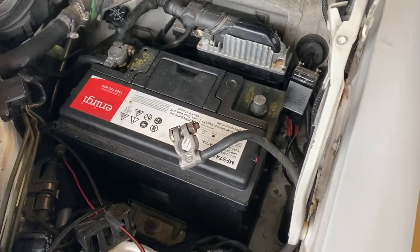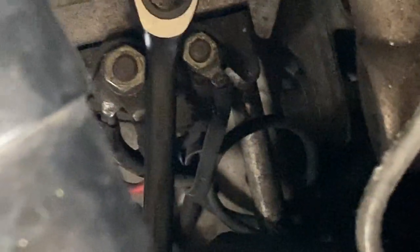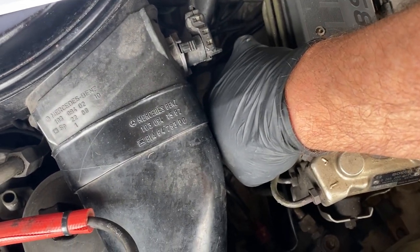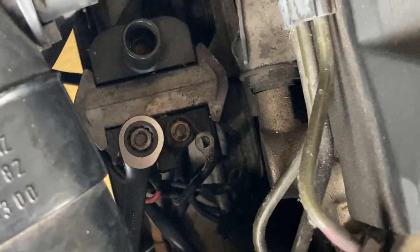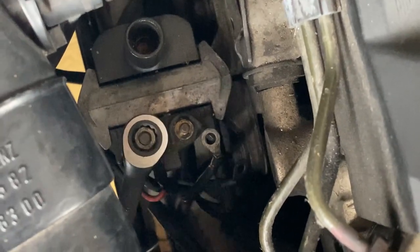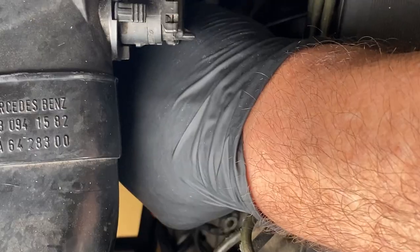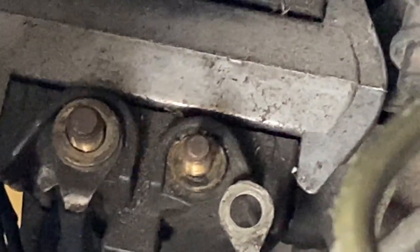So let's have a look at the coil as per the manual. Remove the battery terminal — you'll need an 8mm spanner. These ratcheting sockets are awesome; they save so much time. Remove the nuts off the posts but be careful, there is a washer there that will disappear into forever. Then remove the next post with a 10mm socket wrench, reach down, take the nut off and be careful not to lose the washer.